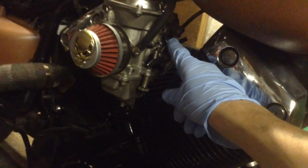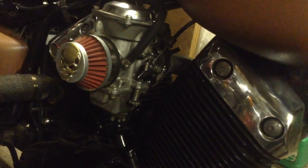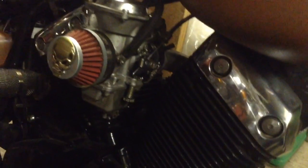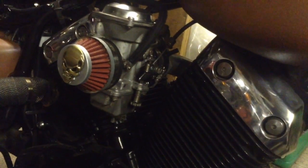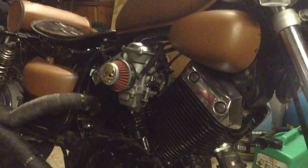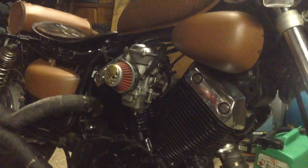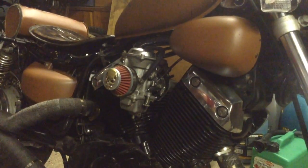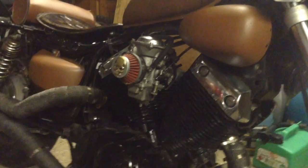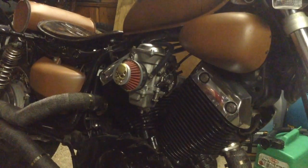It's not one that you solder on at all. It's actually one that just basically screws on. So it's a fairly low tension cable. I'll keep an eye on it, make sure it's okay. If it shows any signs of coming under strain and maladjusting or something, then I'll probably change it to a soldered on one. Personally, from an engineering point of view, I don't see it as necessary. If you look at things like brake cables on push bikes, they're all the same. You just screw them into a unit, and you just adjust them if you need to. So that's that really. So that's the throttle.